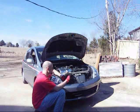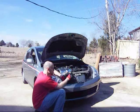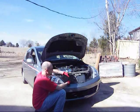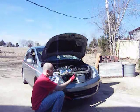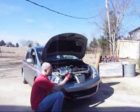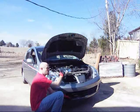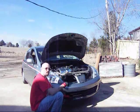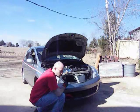Once you do that, you can take a 3/16 drill bit, and you can drill a hole at each of those locations once you take the grill back off. And that way that will provide you the mounting space. You're going to do the same for the opposite side. Do the 2 places there, and then once you're there you can drill your holes, and then we're going to put the top piece back on. I need to drill one more hole for the top. Once you're there, we'll get it all wrapped up.